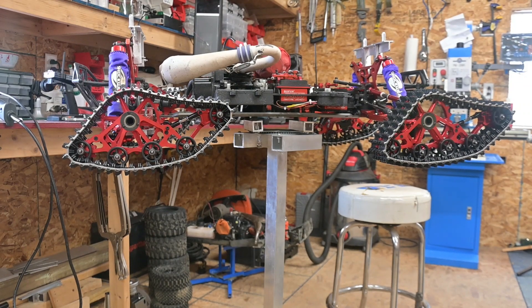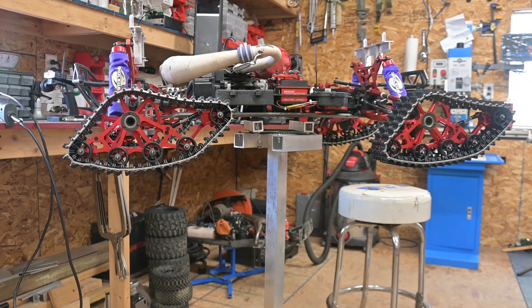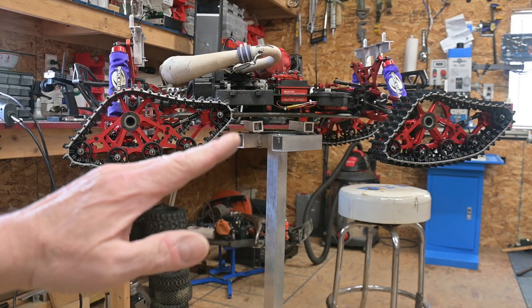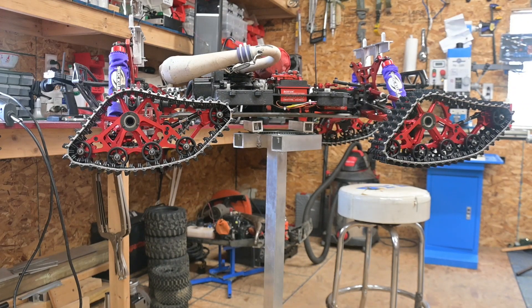This is definitely what I was shooting for — just sitting flat. My issue is I want the most contact possible when it's running in snow, to get the flotation. Even though in theory when they were tilted it would sink in and eventually get more snow contact, in the meantime you've already set the chassis down into the snow quite a ways. I prefer to try to stay up on top as best as possible, let the front track cut a little trail, and critically those tracks need to flex and go over terrain, sticks, and whatever else you run into.